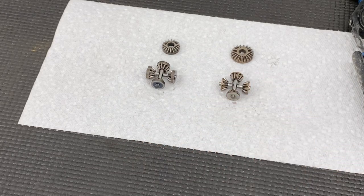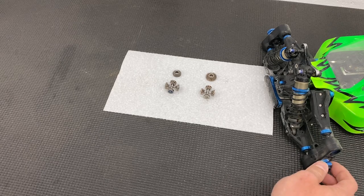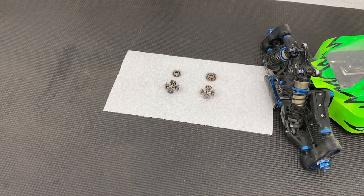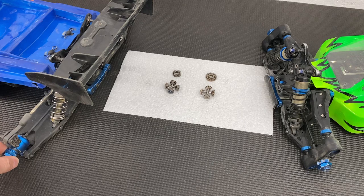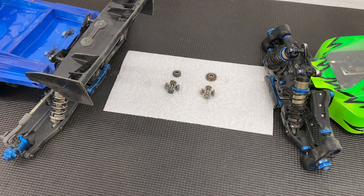You could go as high as 15K in the front if you wanted to. On the car itself, statically on the bench, there is a noticeable feel difference between HTC and LTC. The LTC gears are like butter — the tooth engagement on an LTC gear diff is much smoother than on an HTC. With the HTC you can feel the tooth engagement; it's slight but it's there. On LTC you can't feel the tooth engagement at all — the diff action is just smoother.